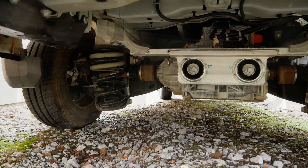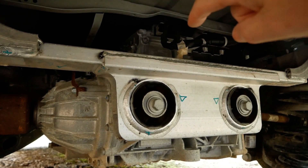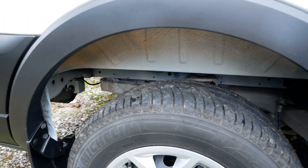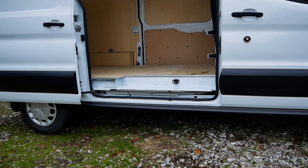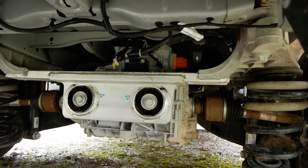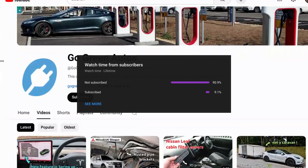This electric motor package incorporates a reduction gearbox and differential, and the inverter up there — that's taking the DC power from the battery and converting it to AC for the motor. The electric motor and suspension sit on a subframe which is a die-cast aluminium casting, and that mounts to the existing chassis rails. So the electric version of the Transit still has the same body shell and the same load height as the diesel versions. Those things that look like fans when you're driving behind the vehicle are just motor mounts — the black is rubber — and there are another two on the other side.